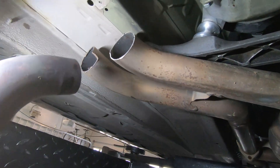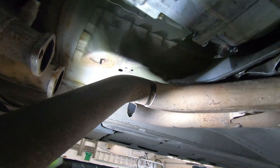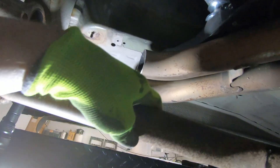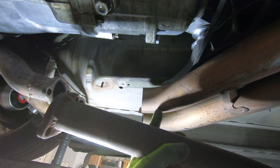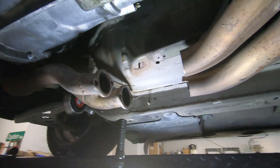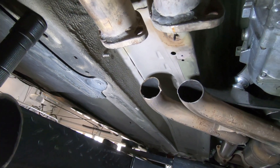I'm feeling pretty good now because this does in fact slide in there, just barely. It's such a tight fit that it's actually kind of difficult to get back off. I cut this extra long just in case, and I thought maybe I'd get lucky and be able to make that corner, but the angle isn't the same and it's way too far away. I'm going to make the cut here and allow it to slide in until the elbow — probably cut around here and trim back as needed. You only need about a half inch of overlap to get a really good weld, but I'm going to get in there as far as I can. This one's pretty messed up so I might clean it up with the angle grinder, but honestly it's under the car — it's the exhaust, who cares, as long as it's not leaking.